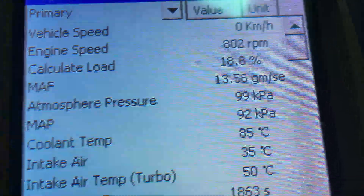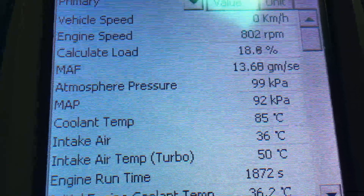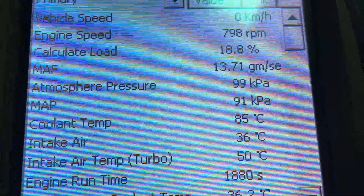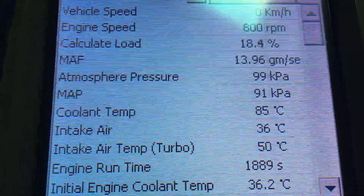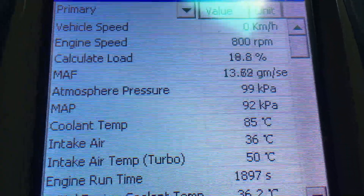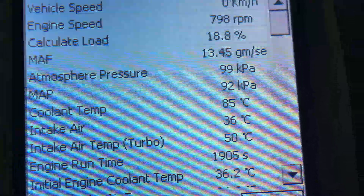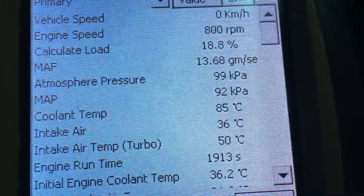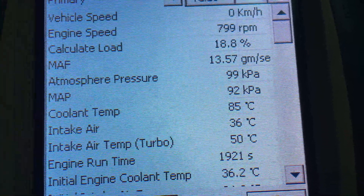The load reading gives you a big picture — if it's going up to 18 without the air con on, you've got some big problems. The readings are different in the 150 Prado and Hilux from around September 2009 onwards when the injectors changed. Automatics and manuals are a bit different too, so watch all the diagnostic videos where I'll be more specific to each vehicle. This is why people misdiagnose — thinking they need injectors when they don't, or confusing load numbers between different vehicles.